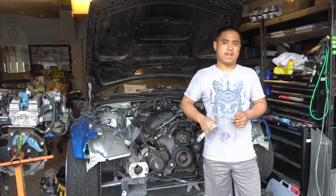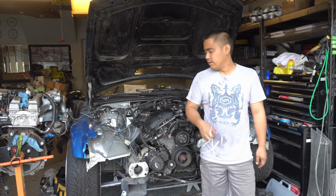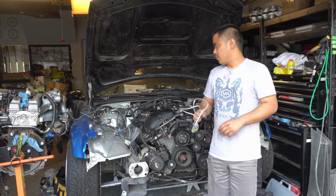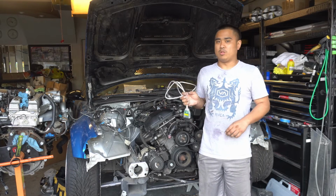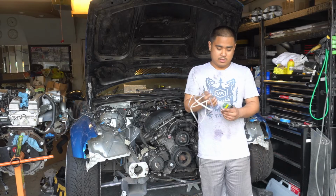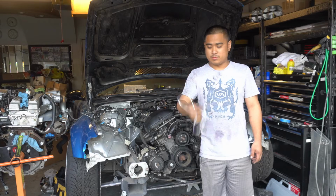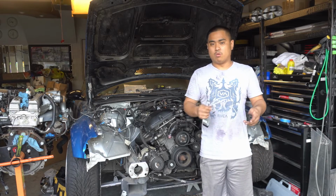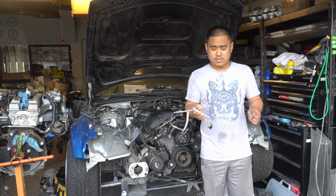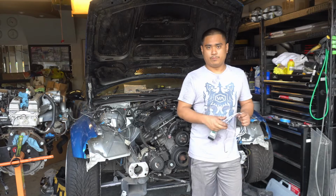let's do this. Now, I hate to break it to you, but if you have any of the other E46 ECUs, like the MS45, I can't really help you here. I think MS42 is going to be a little bit similar, but we're going to be focusing particularly on the MS43. Before you get started, you need to go ahead and grab yourself an INPA cable. It has to be the one with the FTDI chip. I'll link this one down in the description, but you need to get your hand on one of those, maybe even a legit Galletto cable or whatever it is. But you need this to be able to communicate with one of the softwares.